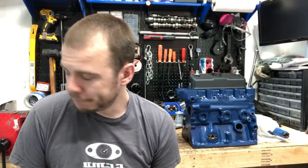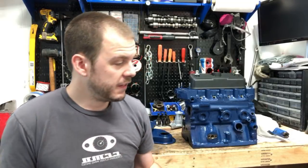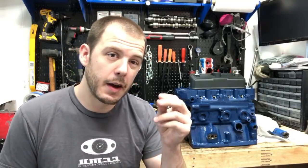Lewis Abbott says that it might be timing. It's possible, although I feel like you'd probably see the timing issues prior to that happening. You have been using it as a daily, but no issues before this. So what I'd be curious about, do you have dual carburetors? Are they HS2s, HS4s? Do you have a single carb? I ask because I've seen this behavior on my car, specifically when the float bowls got kind of gummed up and they weren't delivering fuel the right way.